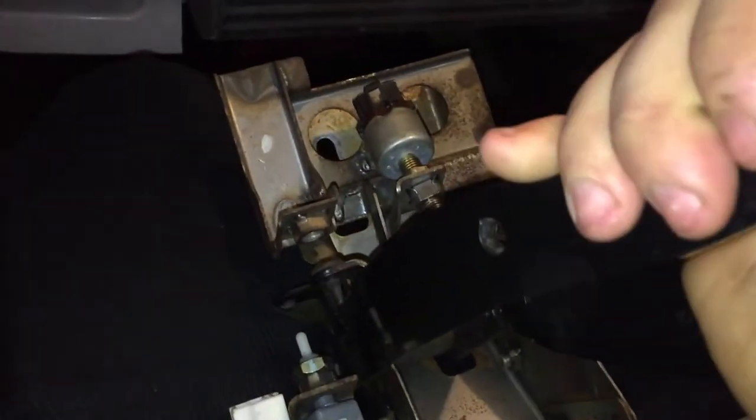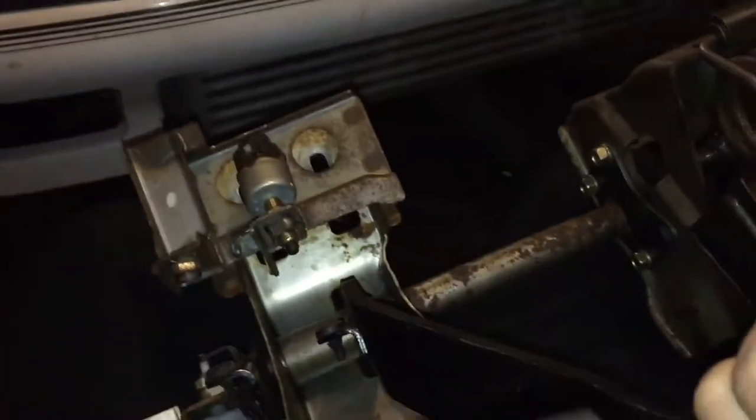Here's the 1G clutch pedal assembly. The clutch pedal is all the way up as it would be in the car. When you press it, you can see the nut moves but nothing else is moving. If I take this spring off it moves a lot more than with the spring on. I'm going to take all this off and weld this bracket onto the clutch pedal — that's what most people say to do on the forums. You can see it starts to move halfway down the clutch.